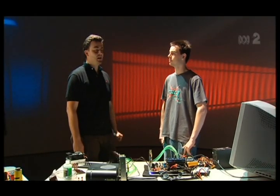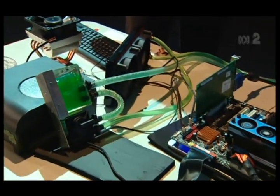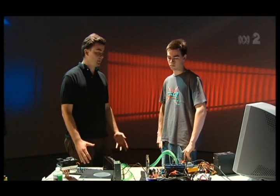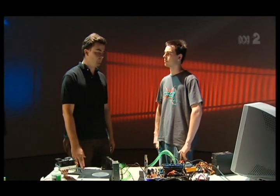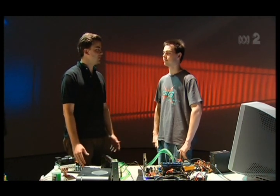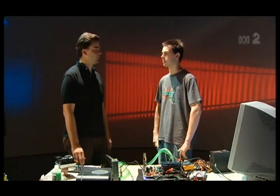So are there any risks associated with water cooling? Yes, but if you're careful, you won't really run into those if you have good preparation. You need to make sure that all the tubing is correctly seated and clamped together. The system has to be tested outside of the case just for water leaking. If it does leak, you could pretty much kill your $1,000 CPU and a $1,000 graphics card. So you have to be very careful.